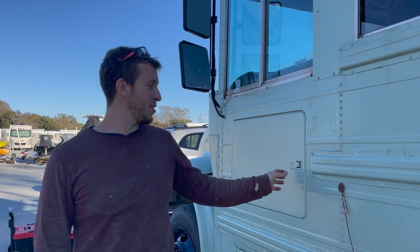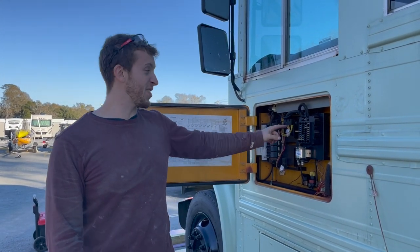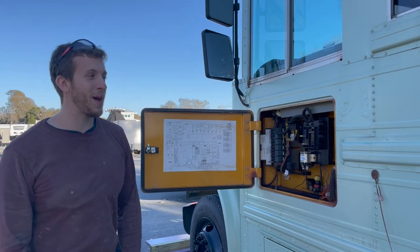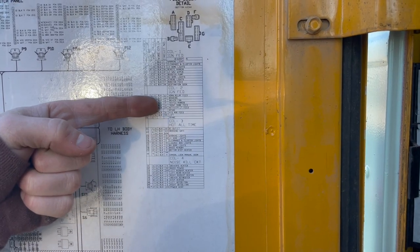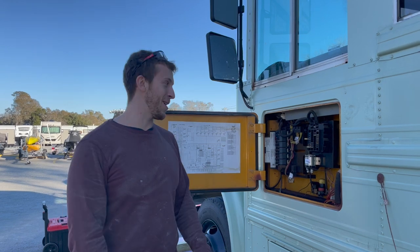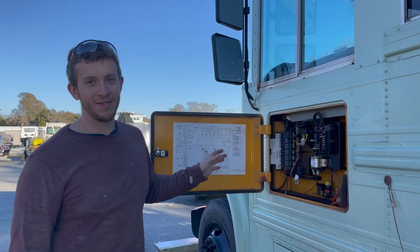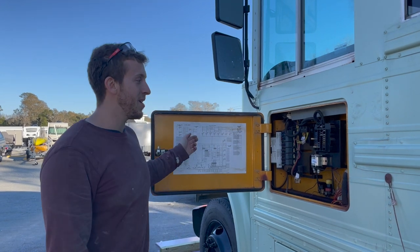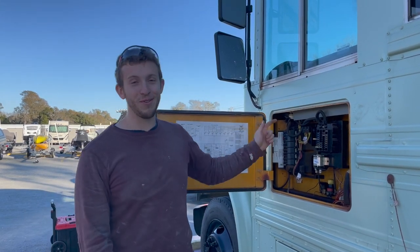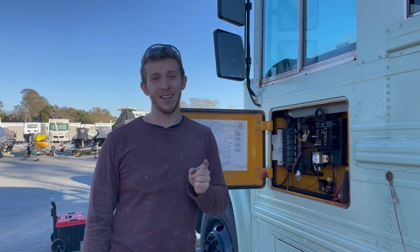This is our bus's fuse panel. You can crack this open and there are a bunch of fuses - there are actually two panels and they're all labeled. Looking at the schematic diagram, some say 'hot all the time' and some say 'ignition feed.' I'm looking for one that says ignition feed so it's only hot when the key is on. They're all numbered and another diagram shows which fuse corresponds to which number. You also have to check whether there's actually a fuse installed - our bus has a radio slot but no radio, so there's no fuse and it wouldn't have power regardless.